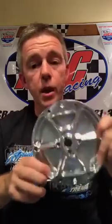That's why these ultralight flywheels, if you notice on our website, it says they're recommended for a balanced assembly, whether that be our billet crankshafts that are balanced for a certain piston size, or some of these other guys that balance stock crankshafts. Jason Rankin, first name that comes to mind, using one of his balanced crankshafts, you can use these ultralight flywheels on those cranks because they're balanced. You can also use them on regular stock cranks, but you're going to feel a little bit more of the harmonic vibrations that I'm talking about with an unbalanced assembly than you would with a balanced assembly. But the heavier ones, the 3.5, 4 pounders, they're light enough to give you better acceleration, and they've got enough mass on them to help with harmonics. And yes, harmonics hurt an engine.